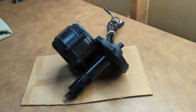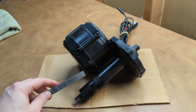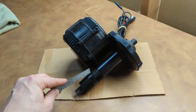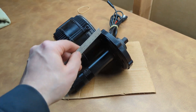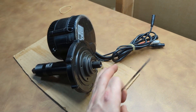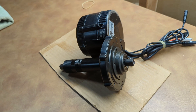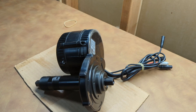Here is our BBS motor unit with the axle extension and axle installed. At the end of my ruler is the standard spindle for a 68 to 73 bottom bracket shell, and here's the extension for a 100 to 120 millimeter shell. There are a couple sets of bearings in here — your driving gear comes out, the axle removes, and there are some locking washers and rings in there that need to be removed. These bearings need to be set at proper offsets.